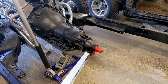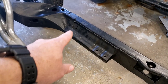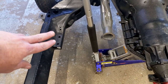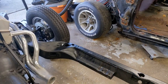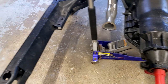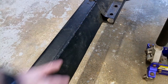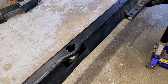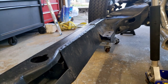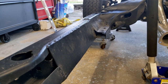Next we're going to get that cross member bolted to the bottom of the trans and to that side of the frame. You can see the extension here goes all the way back — the cross member bolts onto there, comes across, bolts at the bottom of the trans — but on this car the mount is right in here, so we need to make this more parallel. We're going to take essentially that box section, cut it off, and weld it in. I'll probably have to cut it on an angle because of the angle the plate is on, so we don't want it cockeyed. We'll just weld it to the face.